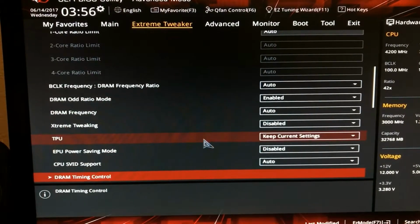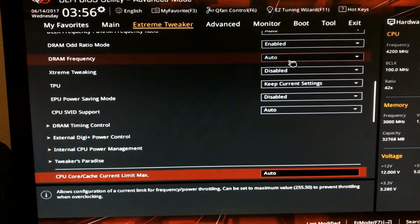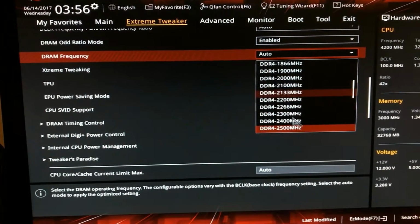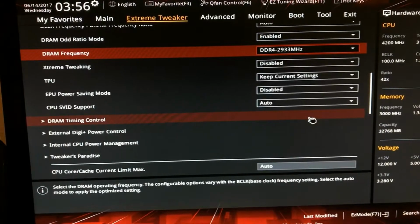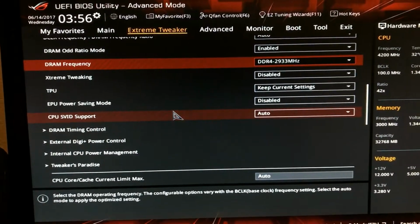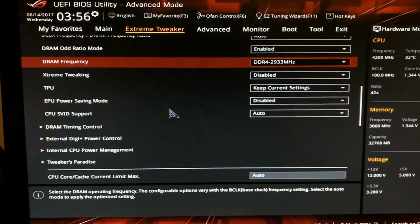Definitely just keep an eye on your RAM there, because it's just going to mess you up trying to do its thing. And it's kind of annoying because this is DDR4 3000, but it just will not run at that speed. It'll post into Windows, but it's not stable. If I run a benchmark, it will freeze. You'll hear some noise coming out of the speakers, all that stuff, and that's when you have a RAM issue